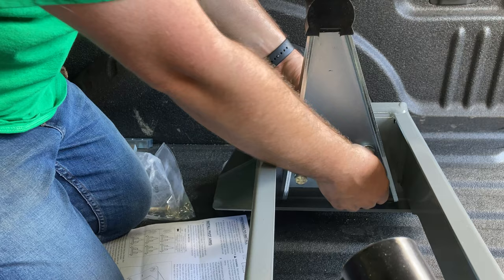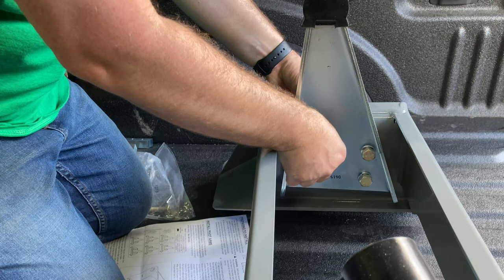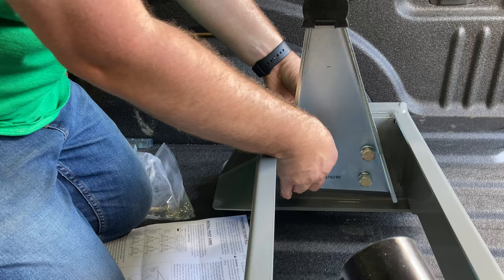You'll see the plates have a side with thread clear out to the edge and a side that's bored. We want to use the bored side up against the mounting bracket, because these bolts have a little bit of an unthreaded section — that gives the bolt somewhere to seat into the bored-out section of the plate. We want all five holes to line up. I am using the second hole down and the second hole up where the bolts are coming through. Do the same thing on the other side — plate with the bored-out section facing in — just making these finger tight for now.